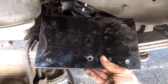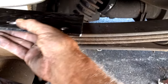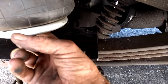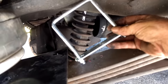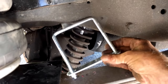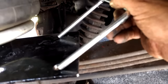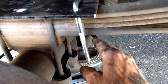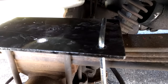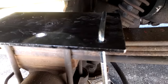What I'm going to do next - I've got these steel plates, same thing, quarter-inch steel. I've got a hole here that's going to go into the bottom. The airbag has a bolt hole for it. I picked up these things at a hardware store and I think they're going to do the trick. I'm going to stick those over the spring and then bolt it on the bottom.